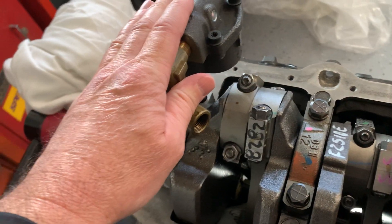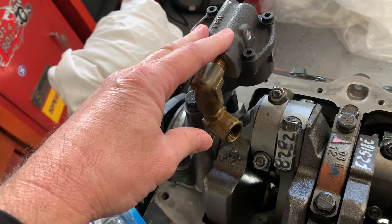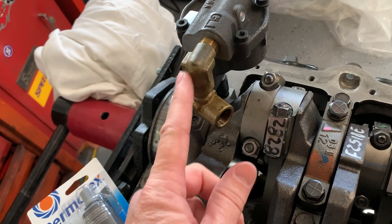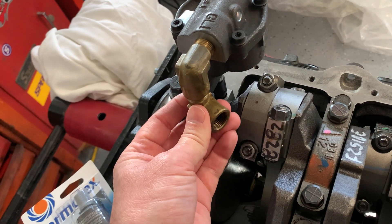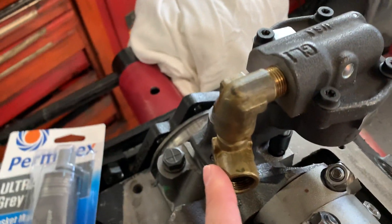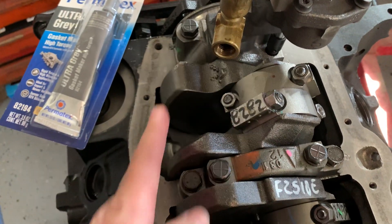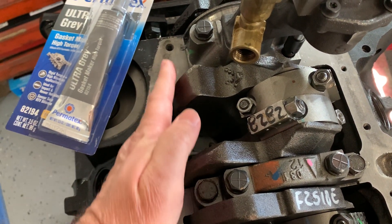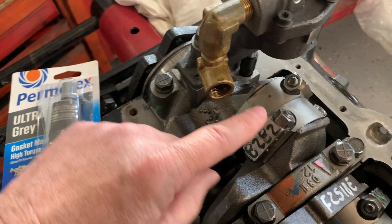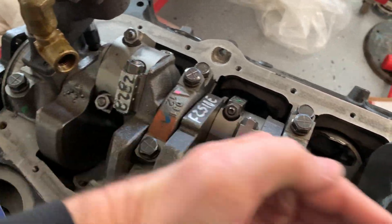So that's the first thing to watch out for. I've got a standard volume, standard pressure, better quality pump. Put your fittings in here — these pipe fittings — and you'll notice that one fitting is straight down but the bottom fitting is turned at a slight angle. That's because the block goes inward on one side, so your pump hose to your sump kind of runs along the side.